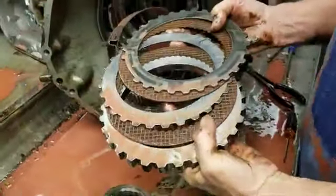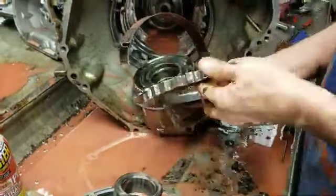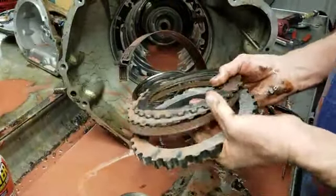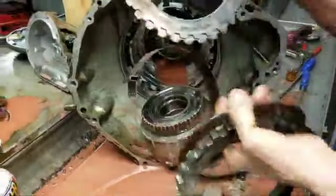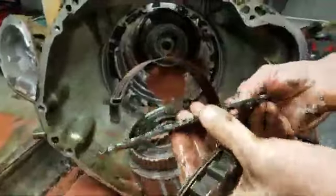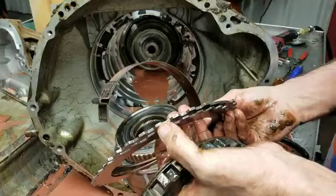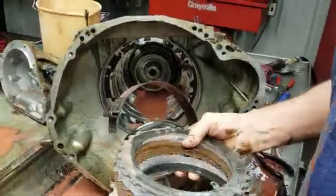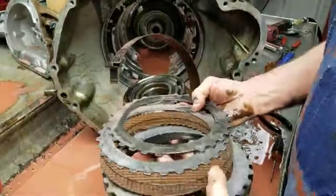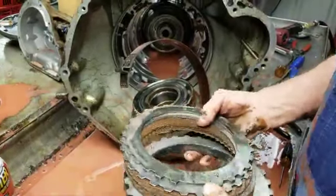There's only two of them since it's just a small 4.9-liter straight six. Now, when you get into the diesel, this plate will be thinner and these plates will be thinner too. See how you've got a thin and a thick metal plate right there — one's real thick and one's real thin. Some of them have thin all the way through. However it comes out, put it back exactly the way it was unless you physically know what you're doing, because there's no map on how to do that.